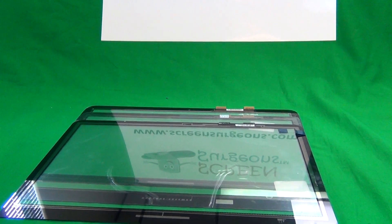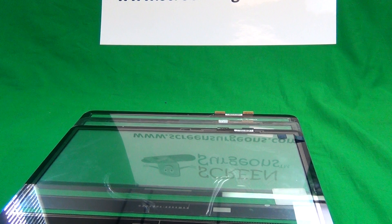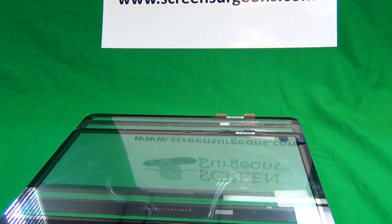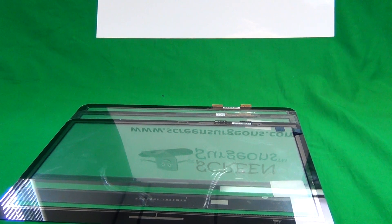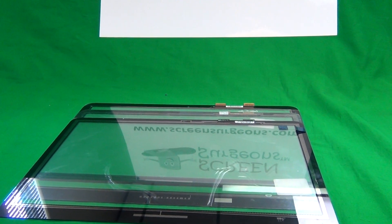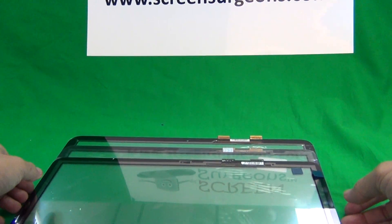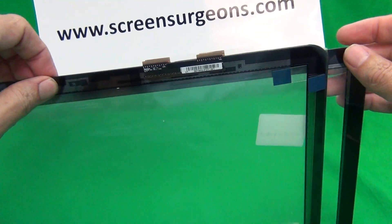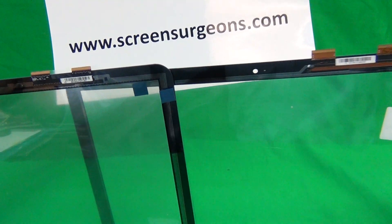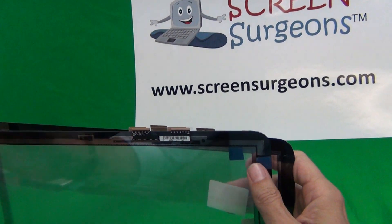The thing that's unusual about this laptop is it has three different types of digitizers. So if you break your digitizer or the touchscreen on your laptop, you have to know which one to order. You have to open up the laptop and take the digitizer out to find the part number, because it's difficult or impossible to tell just by looking at the laptop. Two of them are exactly identical in size and one is slightly shorter.